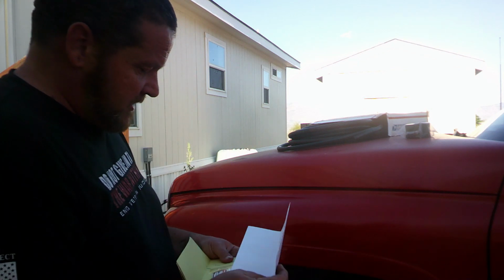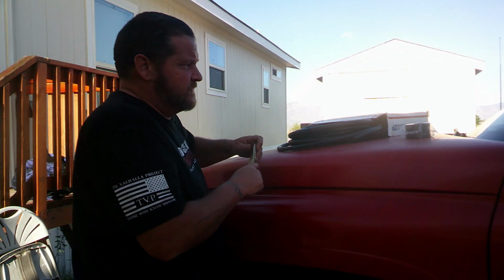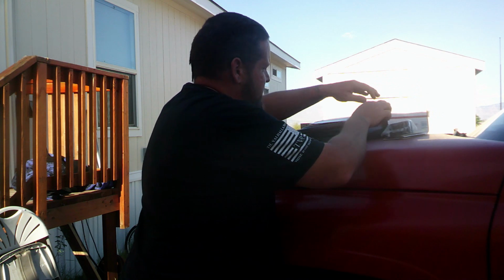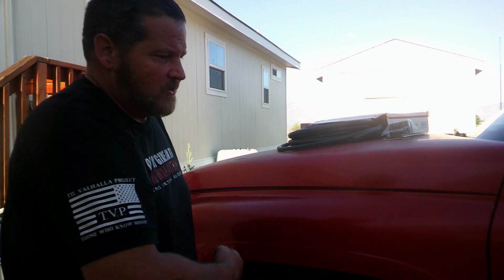And then hose clamps. I, in addition, ordered an extra 2 feet of the 3/8 line because I have the aftermarket fuel filter that we're working on. So I'm just going to take a piece of that, run from the tank to the filter, and then we'll run from the filter all the way up here.